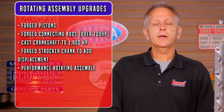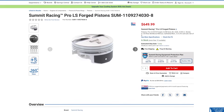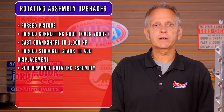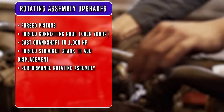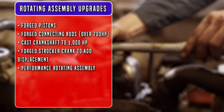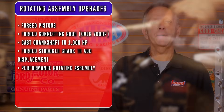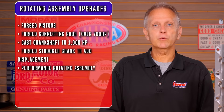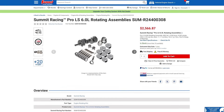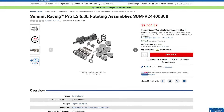Still looking for more? Then look more closely at your rotating assembly. The pistons are a weak point in stock form — a set of forged pistons should be high on your priority list. They have stronger wrist pins, thicker ring lands, and the added valve reliefs allow you to run bigger cams. Gen 3 rods start getting dicey around 750 horsepower and the bolts don't like much more than 7000 RPM. If you're getting forged pistons, it's best to also get forged connecting rods with 7/16-inch rod bolts. The LQ4 and LQ9 cranks were cast but strong and have been known to handle over a thousand horsepower. The main reason for going with a stroker forged crank is for adding cubic inches — the extra cubic inches bring boost on quicker, which means you can use bigger turbos. Performance rotating assemblies are available in many configurations, but it's best to confirm exact deck height before ordering.